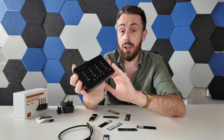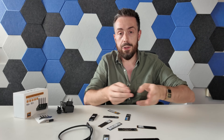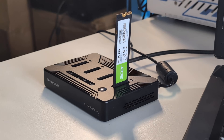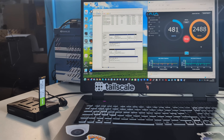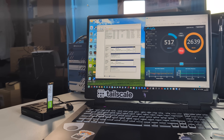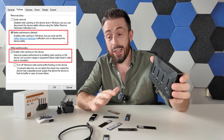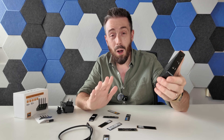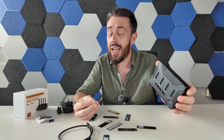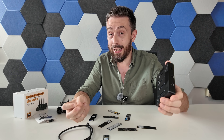Write performance on here was very poor. If you're thinking of using this for OS duplication - connecting it to your Windows or Mac system and duping a live OS drive onto it - you're going to be locked in at 500 MB/s for the write. Duplicating inside the device did a much better job. I got over a gigabyte per second when I enabled write caching, but I wouldn't enable that when duplicating an encrypted drive, because every bit counts when it comes to encryption.